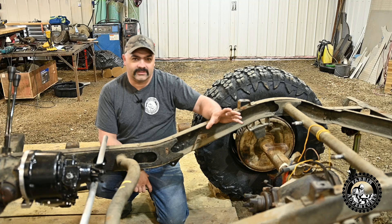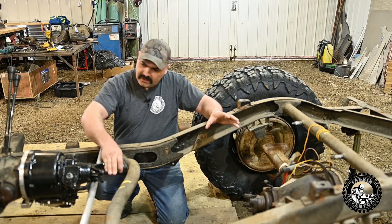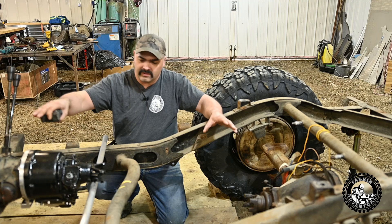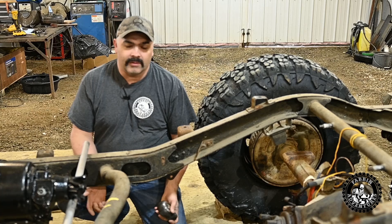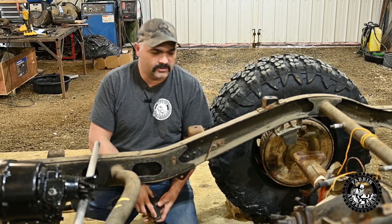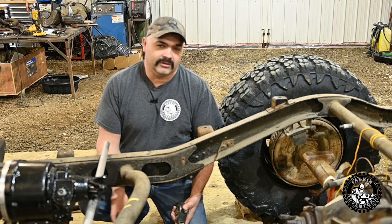Now all we have to do is bring the engine combo down. I think I'm at about one and a half degrees of total driveline angle right now, so I'll bring it down to somewhere between three and five degrees — that should drop things down nicely. I'm not too worried about even a five-degree angle because I'm planning on putting a Holley Sniper fuel injection on this baby, so no worrying about float bowls running out of level and flooding when you're into steep stuff.